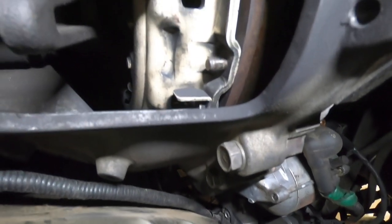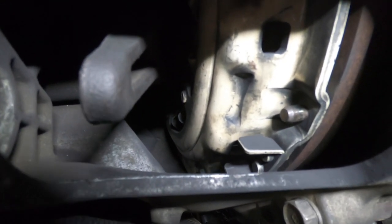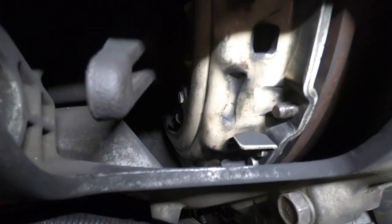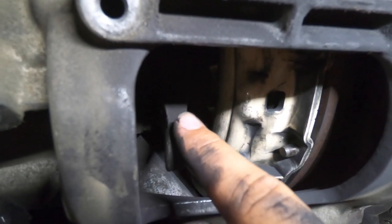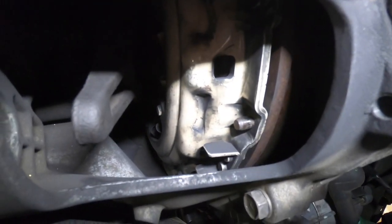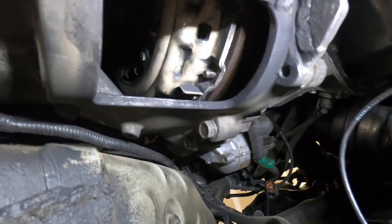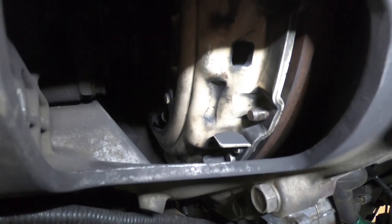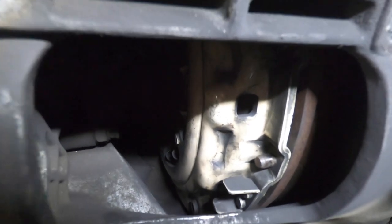You can see in there already — there's a lot of dust but no oil, so I'm pretty sure the rear main seal is fine. When I first separated this transmission from the motor about a year ago, it took a couple of hours because we couldn't figure out why it wouldn't separate. It turned out to be this little fork right here, which takes literally seconds to remove — you just yank it out. We had no idea about that and spent two hours on forums. Now the transmission doesn't take too long. Keep in mind we're not mechanics; we just work on our own cars because shop bills are expensive, but it keeps us learning.